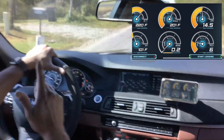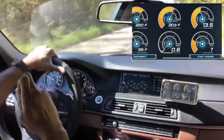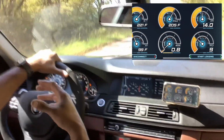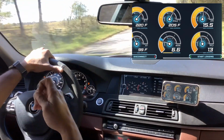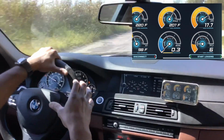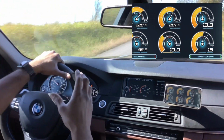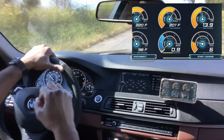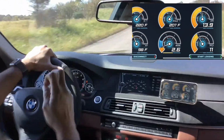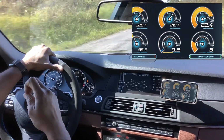And again, I do plan on pairing this JB4 with the MHD back-end flash, which gives you the great benefits of MHD, a lot more, I think, throttle response, just a smoother application. But then you also have the boost control of the JB4, which allows you to boost a little bit higher than what MHD allows, as long as your car is running healthy and you don't have any safety issues that start pulling timing or jumping you back to your stock map. So we're going to give that a shot.